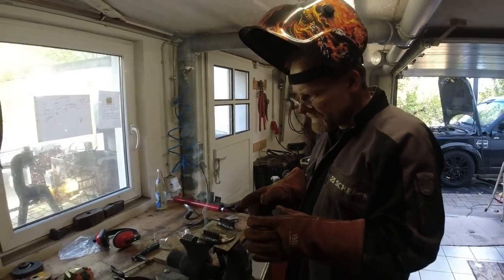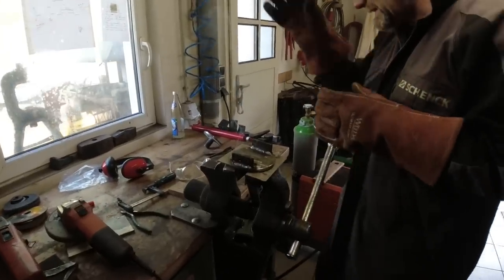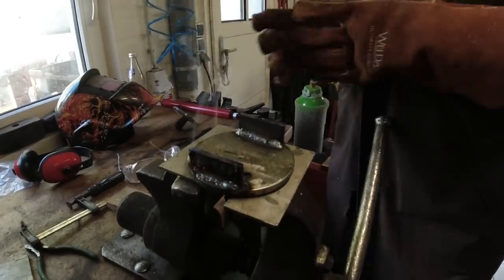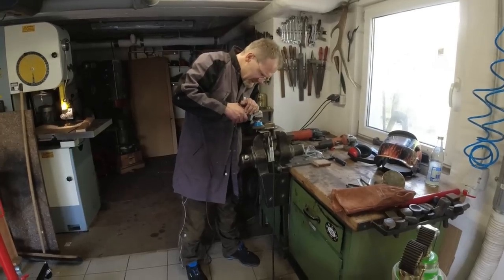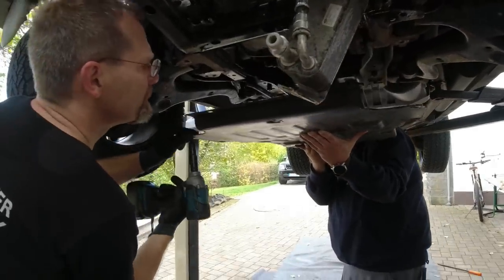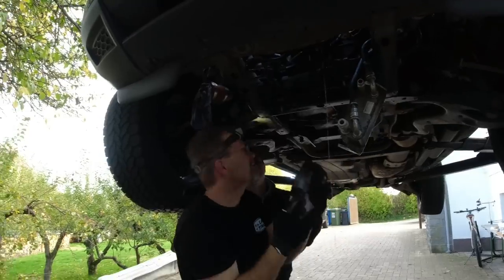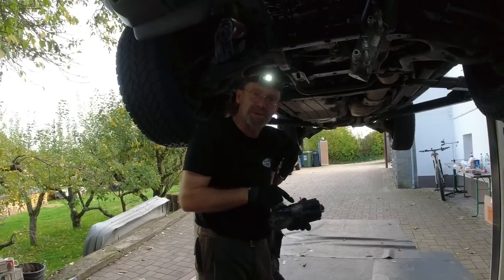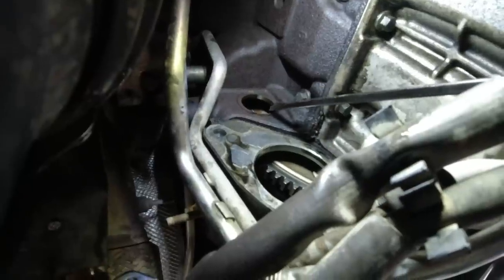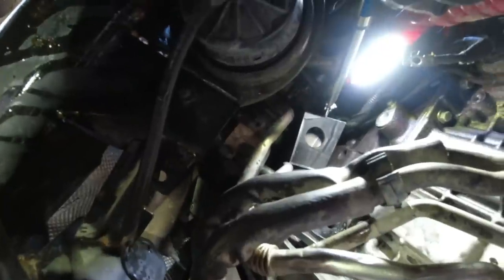I'm done having the car slip around on the two-post lift on these rubber pads — it slid off on one side again, at least an inch. We're going to put an end to that. Christian dropped a bolt but found it. The starter motor was not mounted there — it was mounted over here. I pulled it all the way forward and out. The starter motor was easier than on the Discovery 3. Now I can line up the flywheel to the starter motor hole.